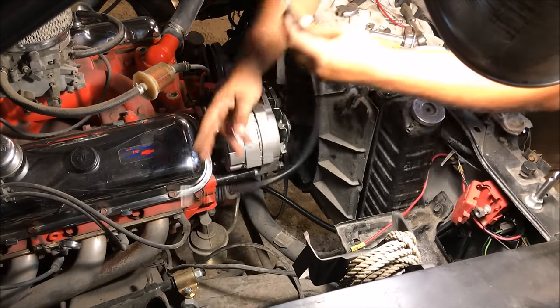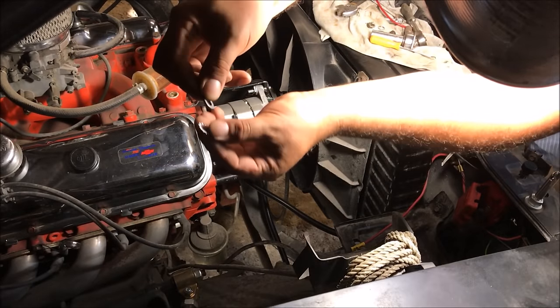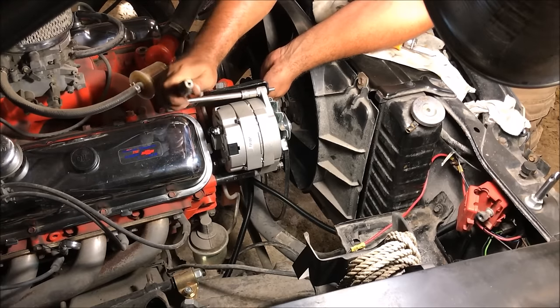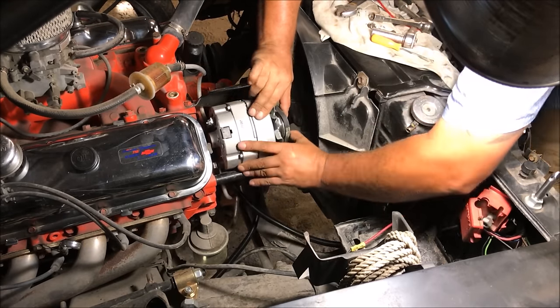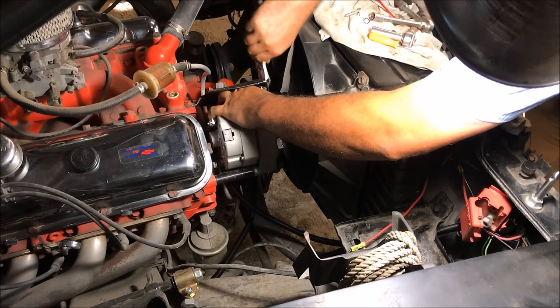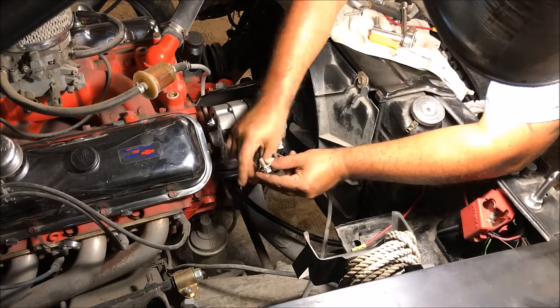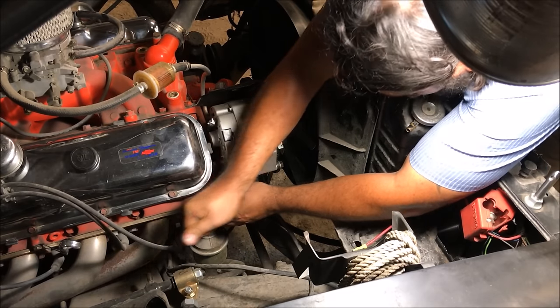When making official grounds, use stainless star washers from Home Depot to ensure a really good permanent ground. We'll use one here and one on the block. The stud goes in and we can go ahead and permanently tighten our ground to this side, adjusting it with a nut and washers. We're using the star washer, a lock washer, and a 5/16th nut - go ahead and tighten it down. The alternator case ground is tightened; we're going to join it back on the block with the original ground coming off the battery.